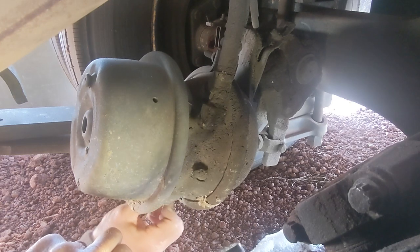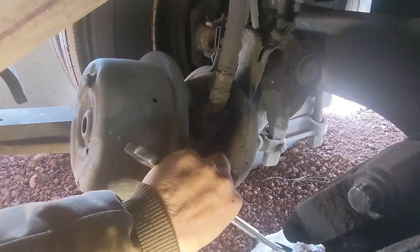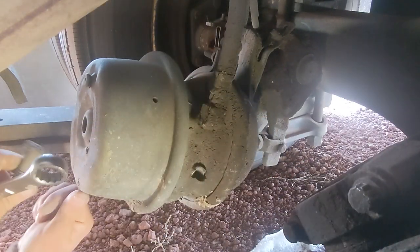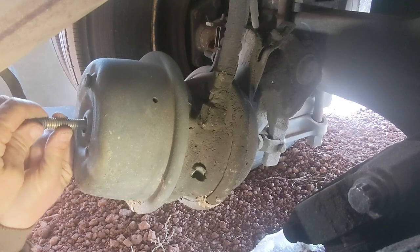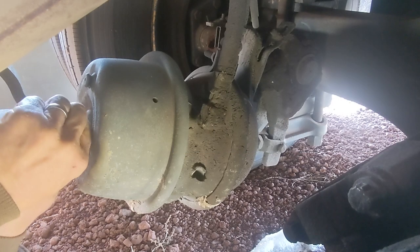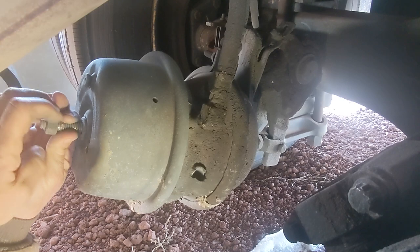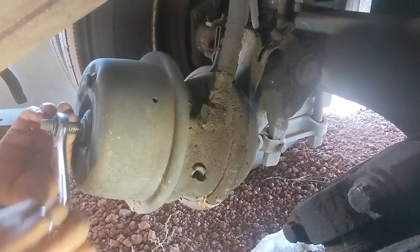Before you can move the bus around on your own property, you've got to cage the brakes. You can either apply air pressure — often there's a fitting on your bus where you can put an air hose — or you cage the brakes like this, and then you can roll it around, but you've got no braking. The caging bolt goes in this end here and you've got to play with it to get it in the slot. There we go — you turn it clockwise to lock it in place so those little tabs stay locked. The threads are a bit bunged up here so I can't quite spin it on.